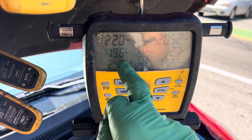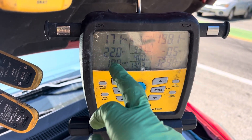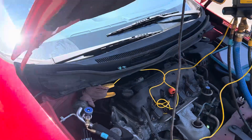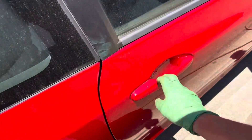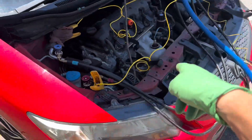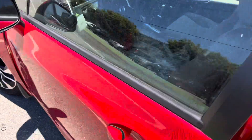There it goes, it's on. Watch the superheat now — this is with it on and running, about 21. It shuts off. Now what we're going to do is load that evaporator up with hot air going down over the evaporator; this will force the cycle time up.